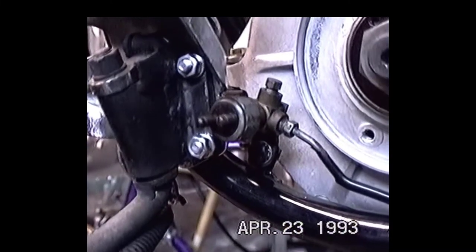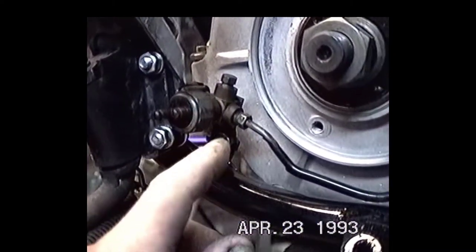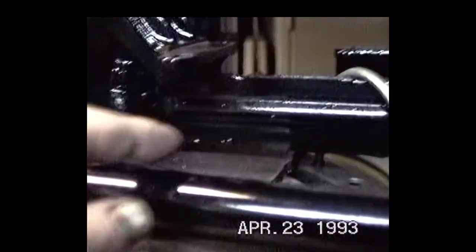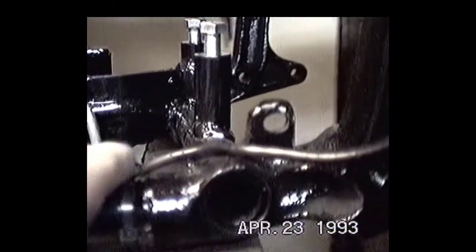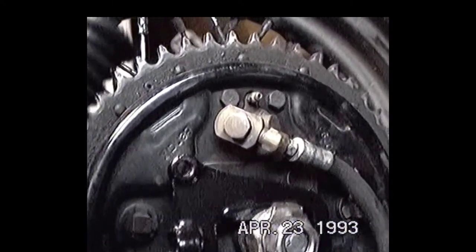Okay, I've been trying to keep a lot of this, like brake parts and things, as stock as I can. This is the way the brake lines for '58 to '69 drum brakes were set up. I try to make this line so it doesn't get cramped or hit by anything or sandwiched. It keeps a nice little swirl so it doesn't get caught by the engine case or anything like that. Then we go up here to the junction, and then we come back to the flexible line, which goes back to the backing plate on the rear